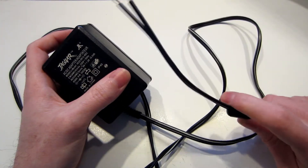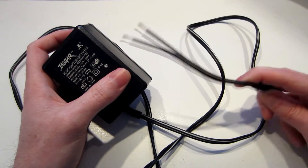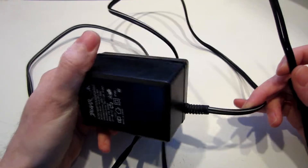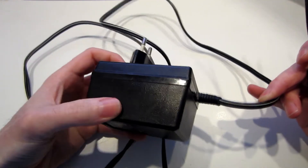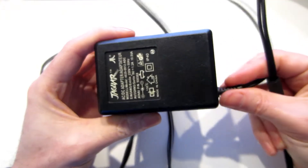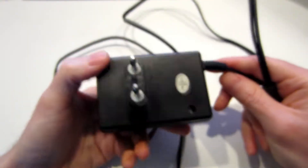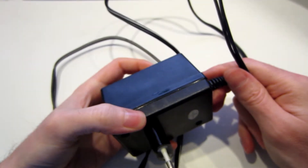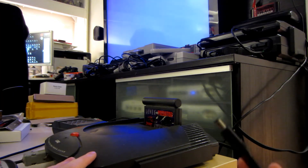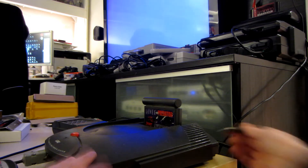I've also tested the original one — this is a 240-volt European one — and I put it in my variac for the European console, and it doesn't output anything at all, so the original power supply is totally broken. I was ready to put a new tip on it, but I think this is why they cut the original plug. The power supply is not working at all, which is a shame. For now, I will just try to make the console work with the Sega Genesis power supply. After cleaning a bit, I finally made it work using the Genesis power supply.